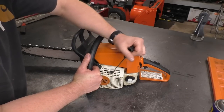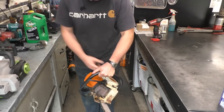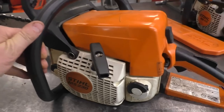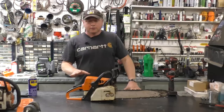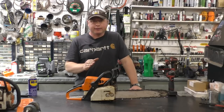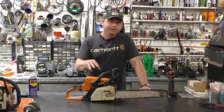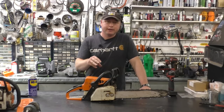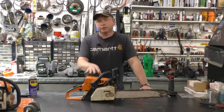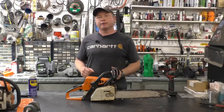I'm going to give this chainsaw a quick start up. So usually on Stihl chainsaws, if you get this issue it will be that small plastic pawl — 99% of the time that's the problem. If you do a lot of repairs, keep a few of these in stock. It's going to be the exact same procedure on most Stihl chainsaws; some may have two pawls, some will have one. Today I did this on the Stihl MS230 and it's the identical repair procedure on the MS250. Hopefully this video has helped you — if it has, please like it and share it with your friends, and make sure you're subscribed to my channel. Have a great day.